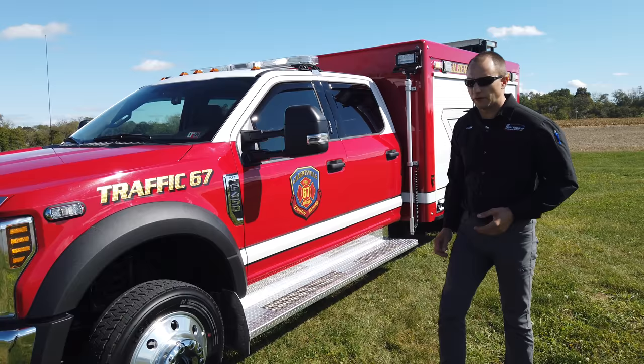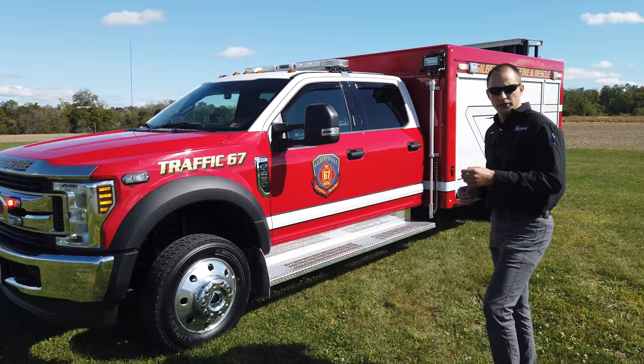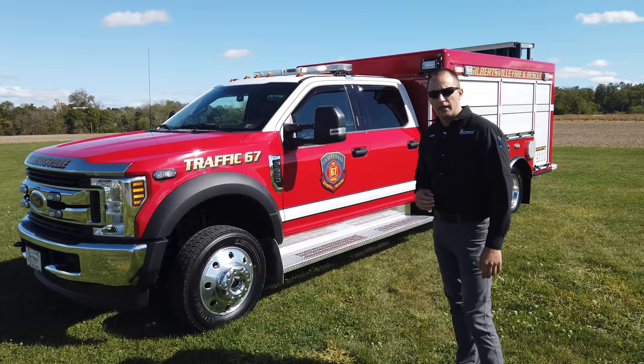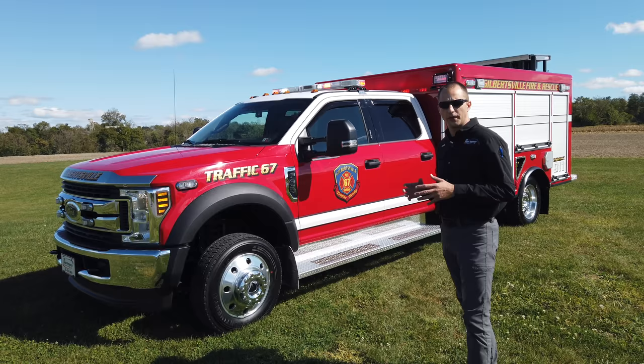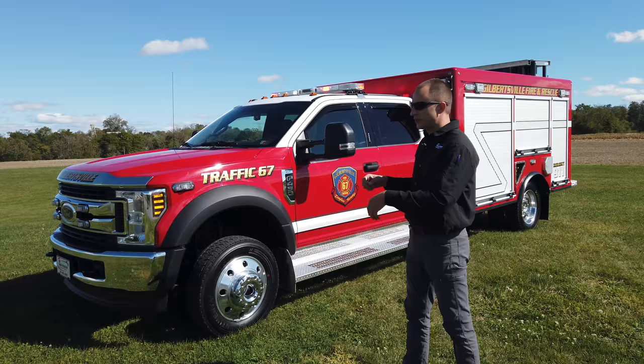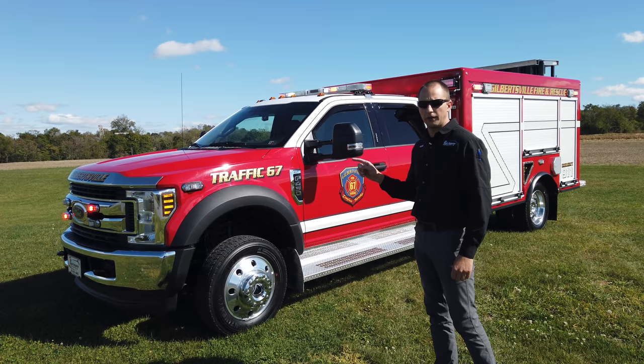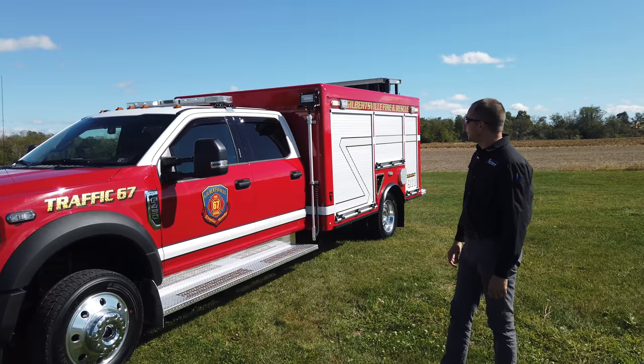This vehicle is controlled by Whelan Carbide. What Whelan Carbide does is we take every light in the vehicle, set it to steady burn, and we actually flash the outputs on the Whelan controller itself, which allows us full control over every light in the vehicle. Synchronization is very important to us — it's much more than a parade look. It's about safety. With synchronized lights, not all your lights come on or go off at one time. That split second when someone sees your apparatus with all lights in the off position, going through an intersection, is dangerous.